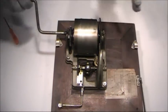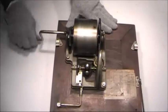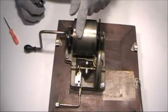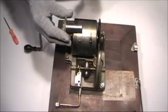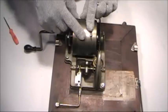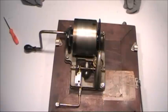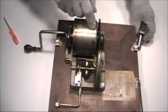This gear on the side has a half shaft, which goes halfway into the spring barrel and inserts only into the first spring. There are two springs inside. From the center of the shaft, the outer edge of the spring attaches to the spring barrel on the other side of this rivet. The first spring winds counterclockwise, and the second spring is attached going the opposite direction — this is how we obtain 34 feet of spring. The drive gear on the other side also has a half shaft and goes only into the center of that second spring.